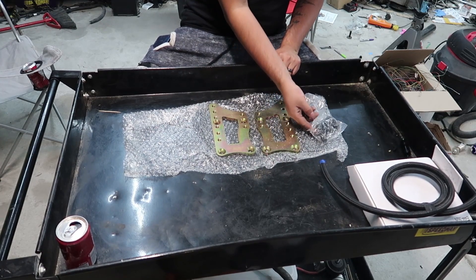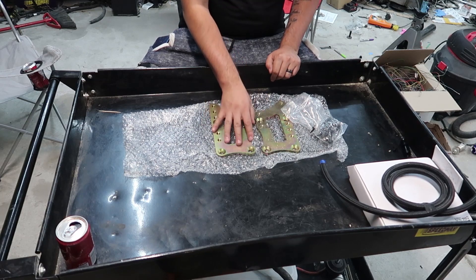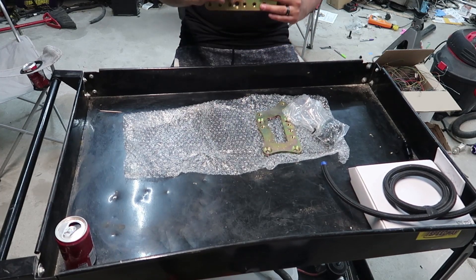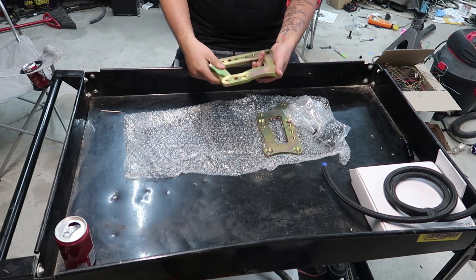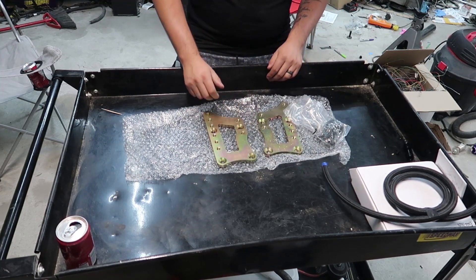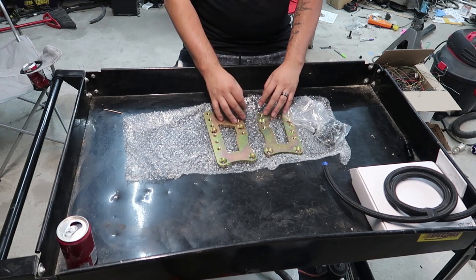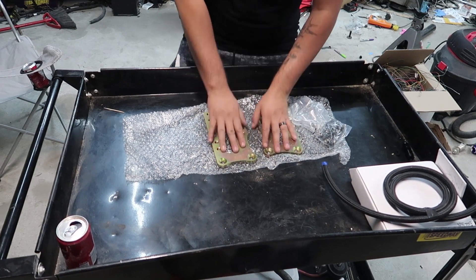It's a really simple plate. These ones are just steel with zinc plating for corrosion resistance, and then you have two different styles of bolts — bolts for the small block Chevy mount, and then a tapered Allen head bolt to go in flush with the motor mount plate. Very simple mount, but they work. These allow you to basically just drop the LS engine exactly where the small block Chevy was, plus or minus an inch. Nothing really to it. I'm sure you could make a mount like this for under $30, but I wouldn't even bother — just get them for $30 online. This is half-inch thick steel; it's not going to be a failing point for your motor.